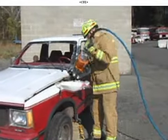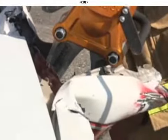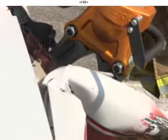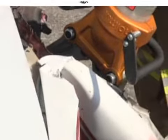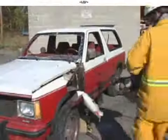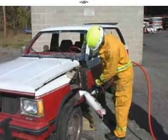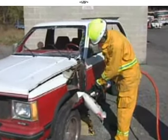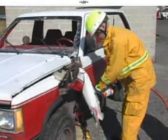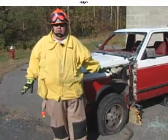This way it'll expose our crumple zone, but you'll notice it will also expose the hinges of the door too, which will facilitate taking the door off right off the bat as well. Now, we're ready to sever our crumple zone.